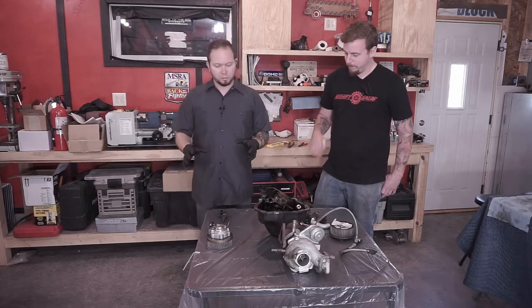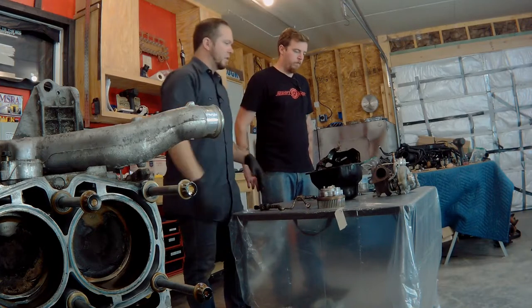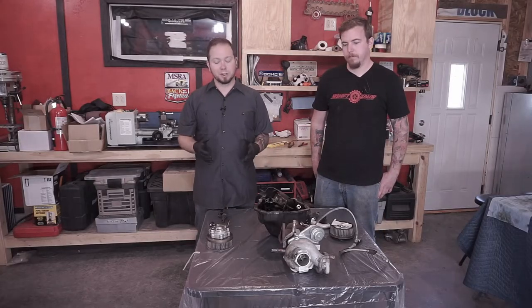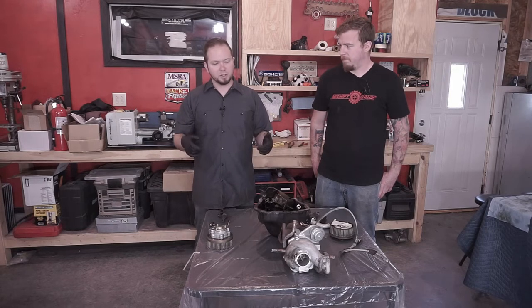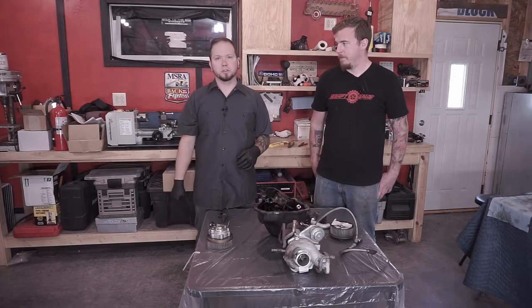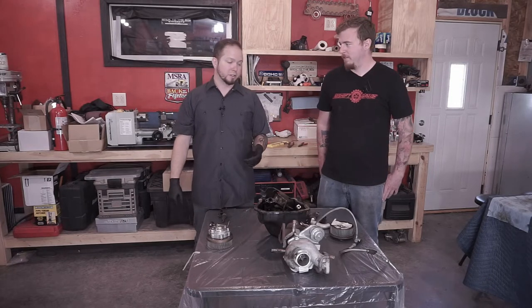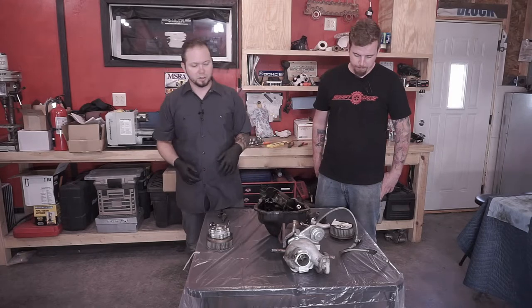One of the most overlooked pieces are the AVCS pulleys. Most people assume that you can't get in there because, according to Subaru, it's a non-serviceable item, but you can actually split them open and get in. Based on the research that we've done, what builds up in there is actually pretty substantial. It's not just a couple of little speckles that could potentially pass through and get picked up by the oil filter. It can actually hold some debris in there. So very important pieces to clean up.